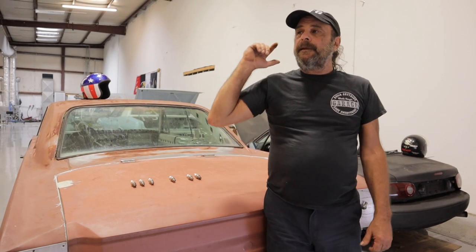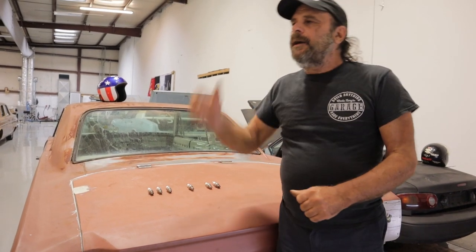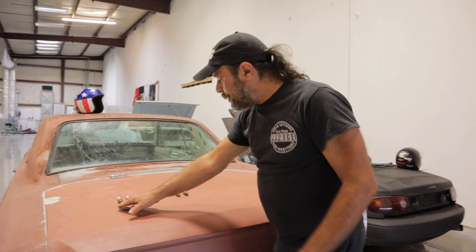It sounded a little deep at the line, but nothing that really got my attention. Tree comes down, I hit it — and instead of reacting the way it did on the street, it held back and stumbled. It just didn't have any oomph. Before I even got to the tree I'm thinking it's a blown run. But as I'm passing the tree the car actually starts to feel good. I hit second gear and it feels good again. Third gear — she just lays down, no pull, no oomph. Shut the car off, coasted around the first shutoff, coasted right back to the pit, and pulled the plugs.